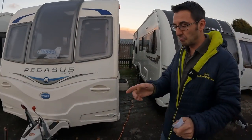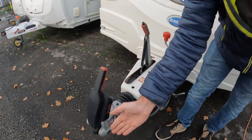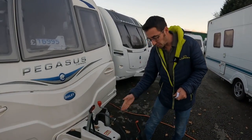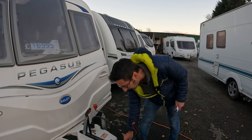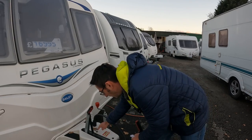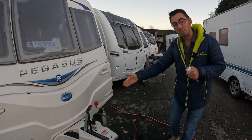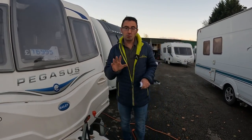The other thing to check is if you've reversed the caravan into place — on the hitch extension here — make sure this has come back out. If it's gone in, that is going to leave the brakes on the caravan as well, effectively like having the handbrake on. Make sure when you've disconnected there's a gap from the hitch to the A-frame. If there isn't, grease up the grease nipples on here — there is one underneath as well — then jiggle and pull this back out to allow the hitch to come back out and take the brakes back off.